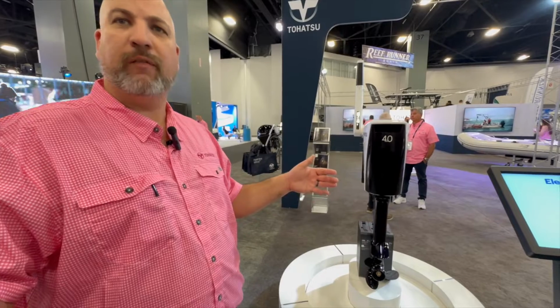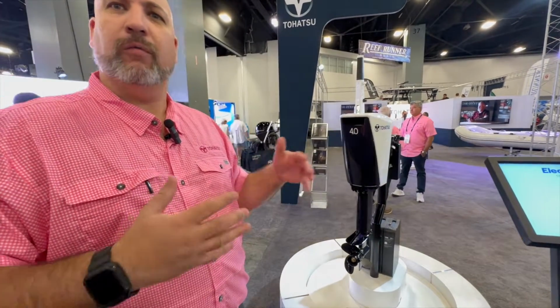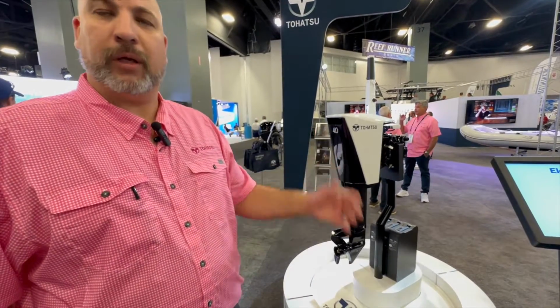Yeah, I actually like that. I mean, that's pretty easy with a 48-volt system. You have a massive range of products. Right. Yeah, you can pick from. Like you could pick 4 12-volt and put them in series. Yeah. You can pick one 48-volt, a little bit larger lithium ion and lightweight, and get a little bit better range. And you're going to get a range of somewhere around 4 to 6 hours for most applications.